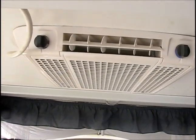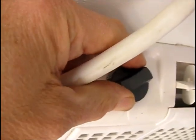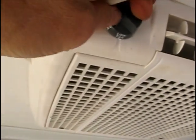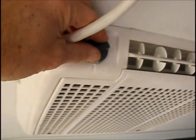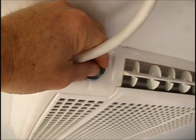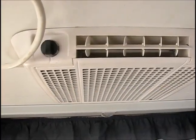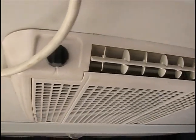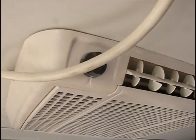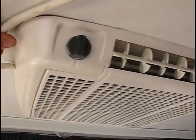We're back inside the camper. Let's test this out and see if the capacitor replacement has fixed it. It looks like we're good to go! So if your AC motor — in this case on an air conditioner — fails to start, always, always consider that start capacitor before anything else. Many times that'll get them going again. Thanks for watching.